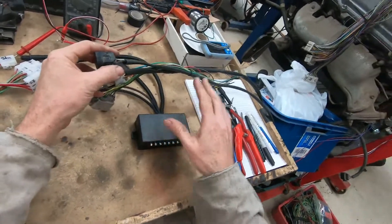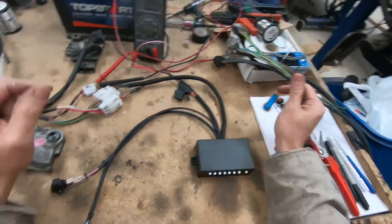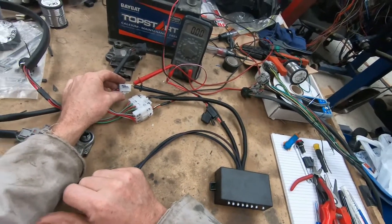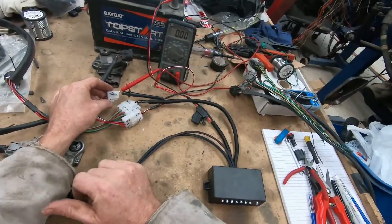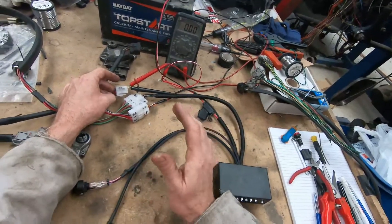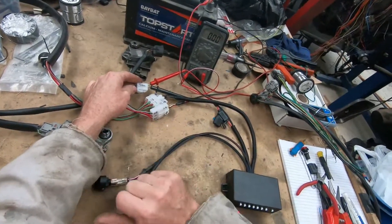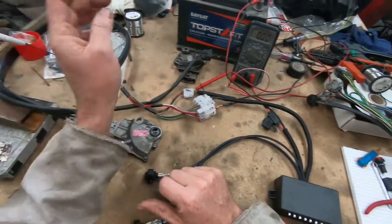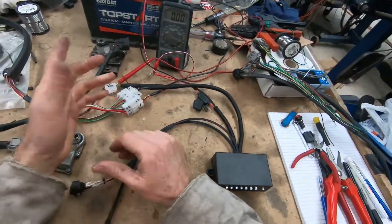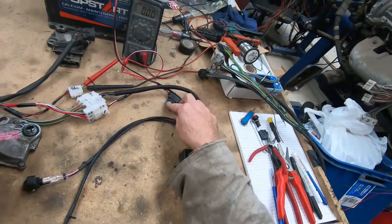Connection is really easy — power and earth, straightforward. I've got a start inhibit switch wired in, so if you want to use it so the vehicle doesn't start in gear, those two wires there can be used to trigger a relay. Don't run directly — there's not enough size in the wires. I've also put a reverse light wire for running reverse lights, if you want to keep it road legal for places like New Zealand. It plugs in via these two plugs and there's a fuse in the system tucked in there.